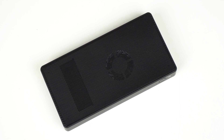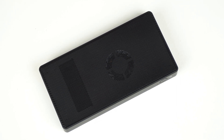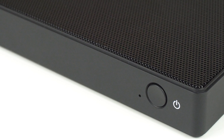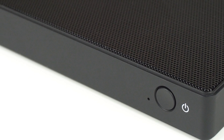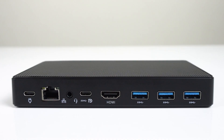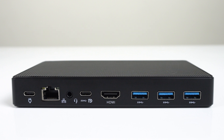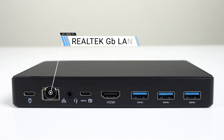I do like the look of this mini PC — it's simple and inoffensive. Build quality is okay; it creaks a little bit, but for the price, it's good enough. The coolest thing for me is the port selection. You don't often see USB-C power delivery or a 10GB USB-C port with display capabilities on a budget unit. There's also an audio jack, HDMI 2.0, triple USB-3 5GB, and a Realtek Gigabit LAN jack.